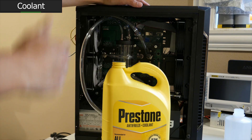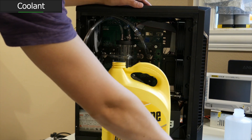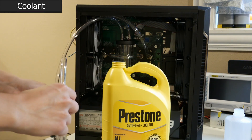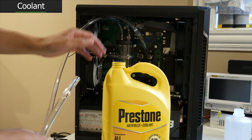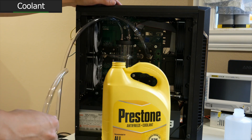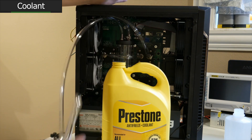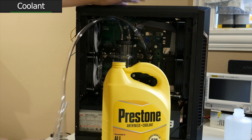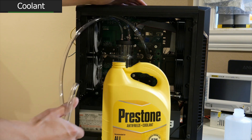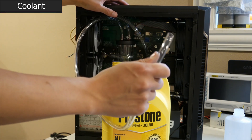I'm a bit disappointed when I look into whether or not this will work. Here's what I did: I went online and looked at some of the available information about the plastics. This is PVC - clear vinyl tubing. These blocks are made of copper, these are aluminum rads, and the plastics used in this pump, including the acrylic, are shown to not have any appreciable effect when left in contact with propylene glycol - which is what's in here - for 30 days. They didn't say what happens more than 30 days after that; maybe things will get brittle, maybe they'll just be fine. But the reactivity of these plastics to this coolant is almost none. Basically, every coolant available for PC water cooling does not allow for mixing metals, and this coolant does.